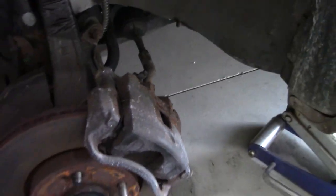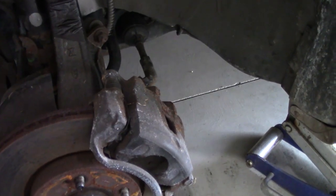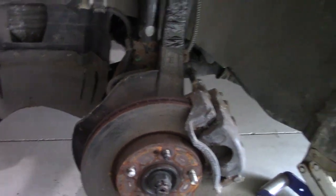The good news is I believe it's only because of this bent part here. The actual tie rod is good. These do come factory with this weird curve — that's 100% original, nothing's changed on that. That's how they're designed. I don't like it, but it hasn't moved, so we're going to let that part go.